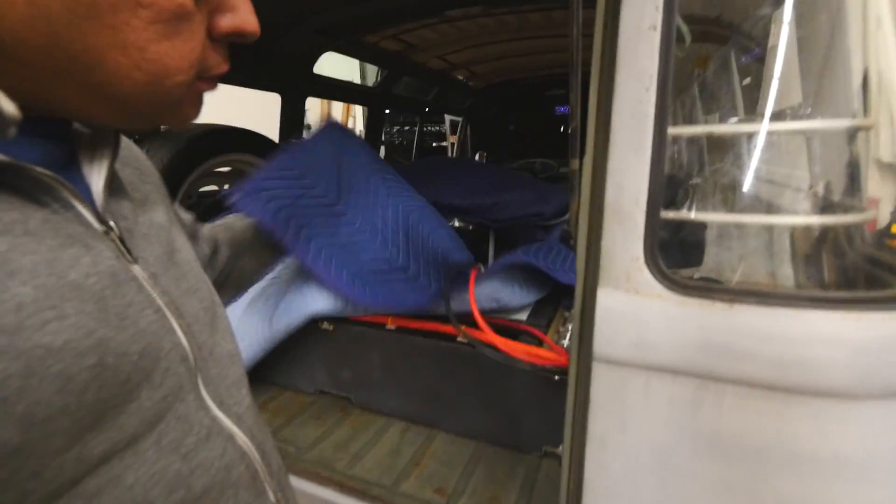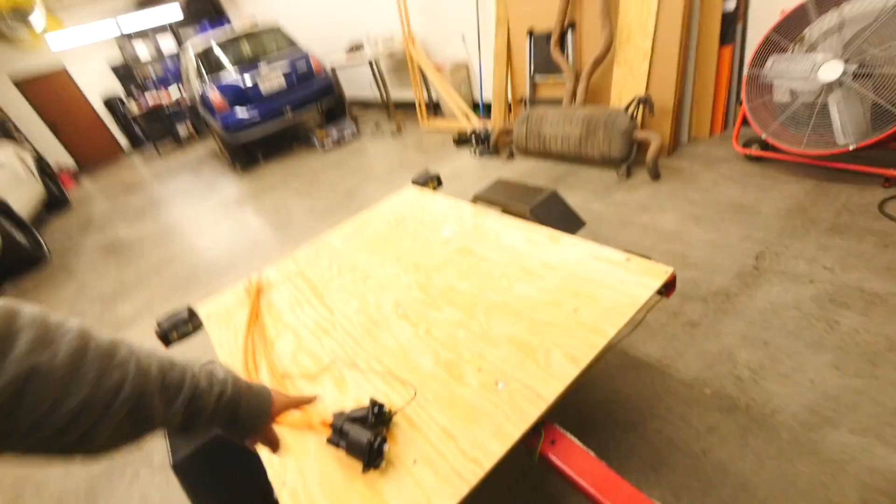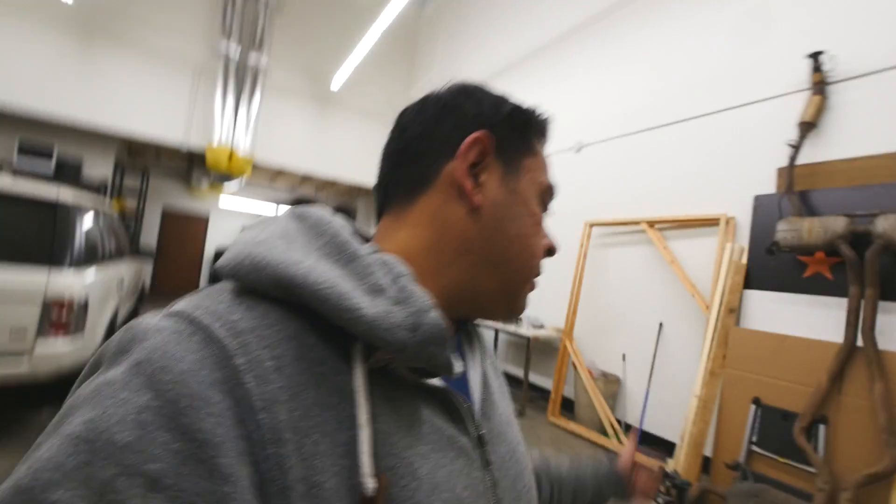Here's what's going to happen: these eight modules that are on the Samba are coming off the Samba and going in here. Then I'm adding an extra six modules that I'm going to take off of the other project we have here. That's going to be a total of 14 modules — 42 kilowatt-hours here on the trailer, plus another 20 on the Samba — for a total of 62 kilowatt-hours, which I believe is going to be 200-plus mile range on my Samba for the trip. That's more battery than any DIY vehicle I know of. 62 kilowatt-hours — that's like a Model S. Crazy.